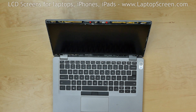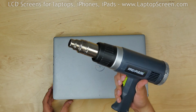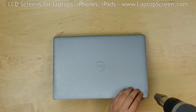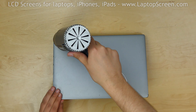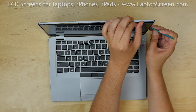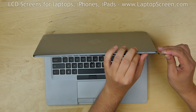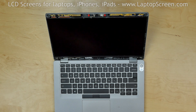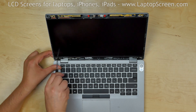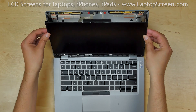We assumed that the LCD screen is held in place by two strips of glue on the left and right sides, which is a common LCD mounting method nowadays. Using a heat gun, start warming up the glue. Use a plastic pick to pry off the LCD screen on the right side. As it turns out, the adhesive was attaching the screen to two removable rails that are hooked in at the top and held in place with one screw each at the bottom. So the correct procedure would have been to go for the two bottom Phillips screws, then putting the screen on the keyboard.